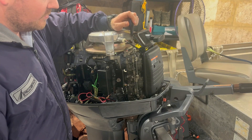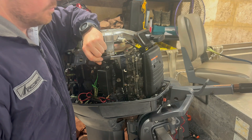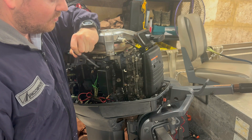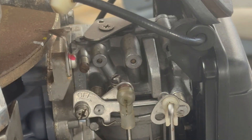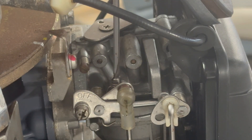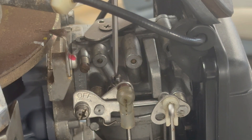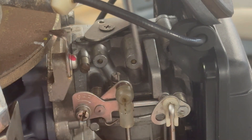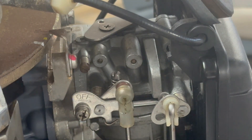Now we're at the more interesting parts of the adjustment. The first thing we want to do is sync all three of these carburetors so that when closed, all of the butterfly valves are closed — you don't want one carby feeding more air and fuel into one of the cylinders on idle. We're zoomed in on the number one carby. This screw here is the idle adjust screw — we wind this all the way out so there's no tension being applied to this linkage, so it's free to return to center.